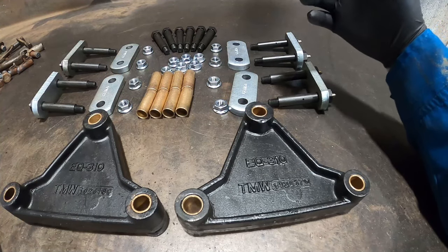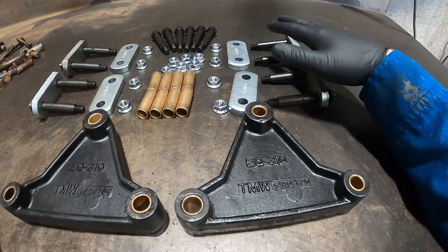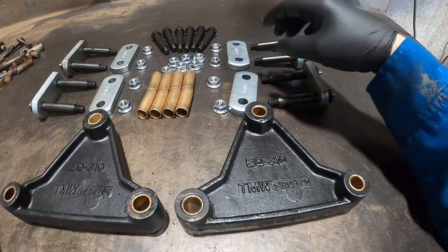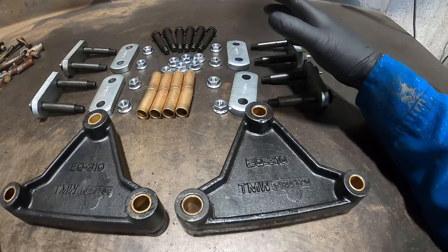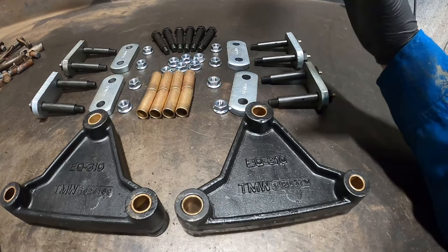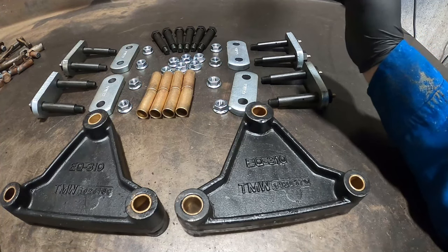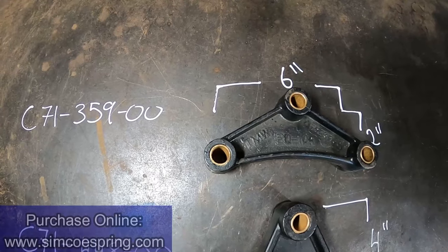The cons are, this is a much more expensive kit. You're looking at like 2 to 3 times the cost of a normal kit, and it must be greased at least twice a year at a minimum. However, that's not worth doing if you don't use your trailer a lot or you do low mileage. If you're doing low mileage or light loads, stick with your plastic kits. They will do you just fine.